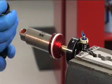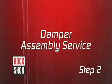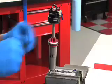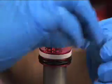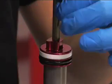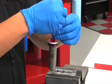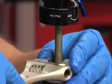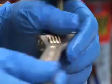Remove the negative spring bumper from inside the air can. Using a 2mm hex, unthread and remove the bleed screw located in the red seal head. The white compression ball may float up through the bleed hole — this is okay. If this happens, simply remove the ball from the bleed hole. Using an adjustable wrench, loosen and remove the seal head and shaft assembly from the shock body.